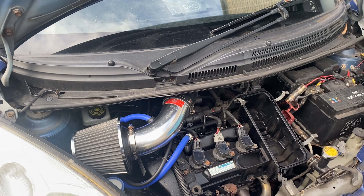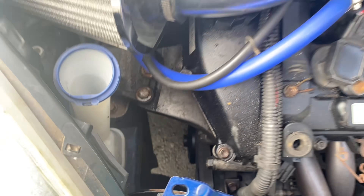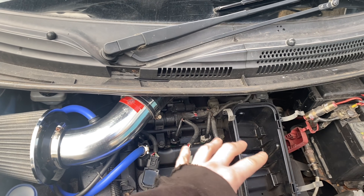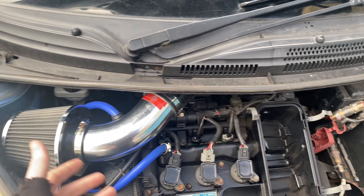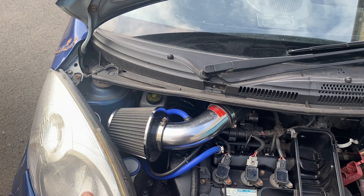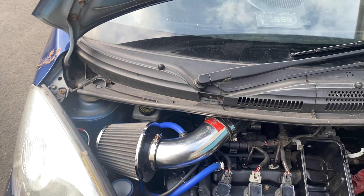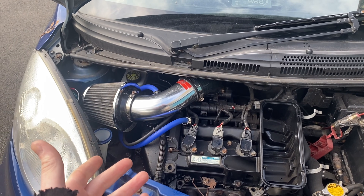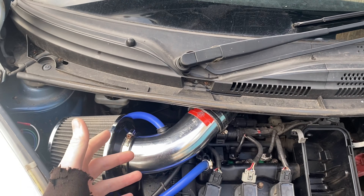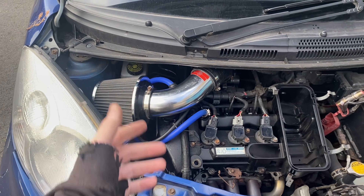As you can see from that, it actually appears to be slightly better in just about every way. Now these cars are different to a lot of modern cars in that they don't really have any kind of sealed engine bay. On a lot of cars, fitting one of these would be a hot air intake, but on these the standard air intake is pretty much right above the exhaust anyway. On a BMW, for instance, there's a sealed cold air feed to the front. I used to have a Volvo T5 — I fitted a K&N 57i, similar to this, and it was great for about 10 minutes. Then I got stuck in traffic one day, the MAF sensor failed. It had melted the glue around the MAF sensor from the heat. So hotter intake is not an unfeasible thing, but on these cars it really isn't going to matter.